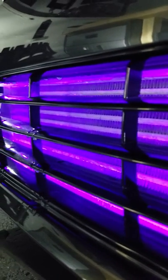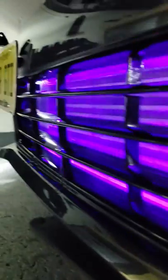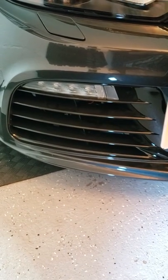Here is a spray pattern demo — it's hard to see but it is misting a lot in there. You can see the spray pattern in there and it is misting a lot. I even installed some black lights in there with UV dye to show the spray pattern effect coming in. It's not lighting up as well as I wanted to, but it is really wetting down the intercooler. Just imagine that at driving speed — air blasting on that wet intercooler surface, and potentially the external oil cooler or any other radiator you may run.